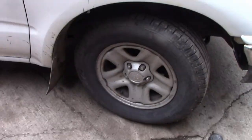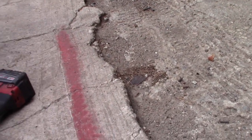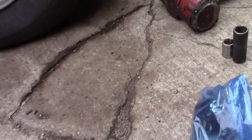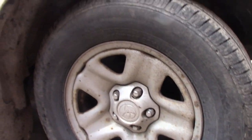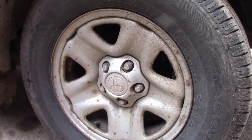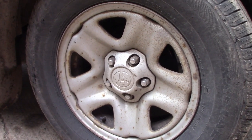We have a couple tools on the ground today because we're going to be replacing the lower ball joints on this Toyota Tacoma. Apparently they're the same for four-cylinder and four-wheel drive, so these are the ones I bought — I just went into Napa. I like it because it came with new hardware in the bag. I got a driver's side and passenger side. The driver's side broke while I was driving, so I've already replaced that one — now I'm going to replace the passenger side so they have a relatively similar life expectancy.